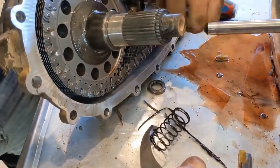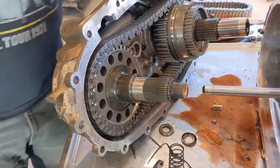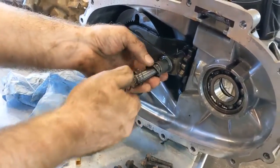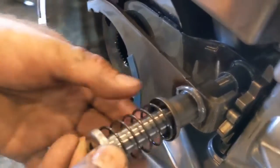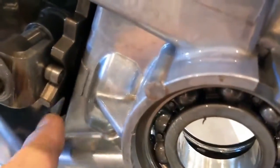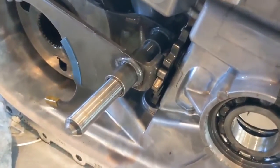We're going to get it apart. The fork part came out, so take a look and see where stuff goes. We're going to add some pictures and we're also going off pictures from one of the forums to verify stuff when we go to put it back. Now we're going to pull off the spring with the cups — notice these springs have little cups at the ends. Pull those out and identify the order. The last transfer case build we did, the location of the indent gave us a couple of fits until we figured out where it went, so take pictures. Then take the fork out.